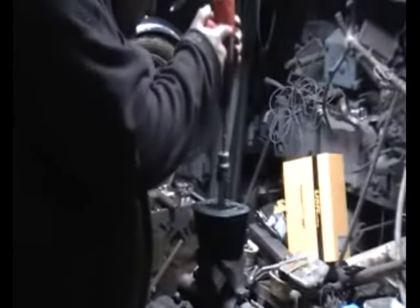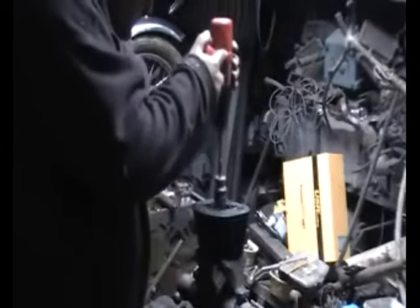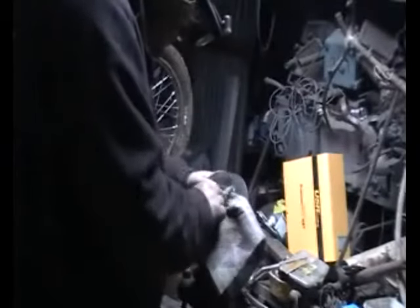Here you can see me honing the barrel. I don't think it had done many miles before the big end blew and it was stored for the last 40 odd years. The barrel cleaned up really well, so it was more to let the rings bed in than to take any marks out of it. Sometimes it's amazing how these bikes can sit up for so long and still come out unscathed.